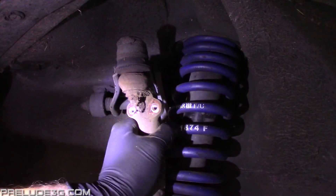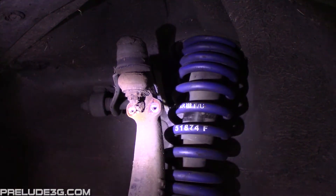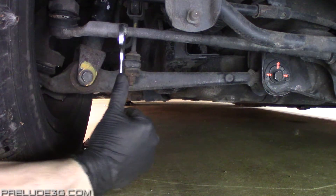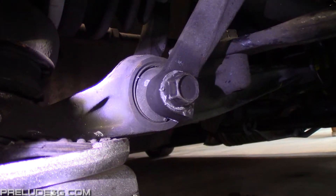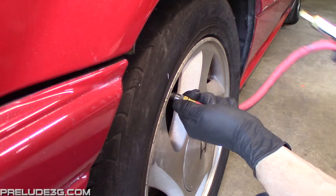Inspect the steering and suspension ball joints and bushings. If you have anything like this, you need to fix it, otherwise the alignment settings will never stay. You'll also want to go through and loosen, then snug up all the adjusting nuts and bolts. Confirm all the bushing positions are neutralized — I'll have a video for that in the description. Make sure all the tires are set to the correct air pressure.